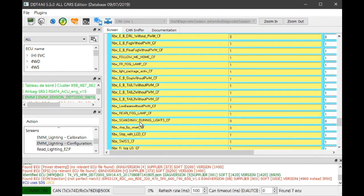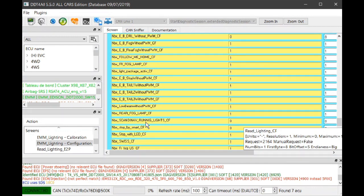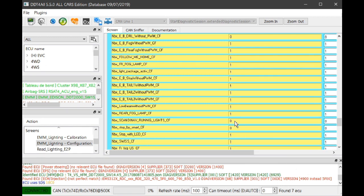'Scandinavian running lights' — in Scandinavian countries there's a law that dipped headlights must be on all the time when the engine is running. If that's set to 1, every time you start your Clio the dipped headlights will come on as long as the engine is running — regardless of what you've done with the light stalk. When you turn off the engine the headlights go off. 'Stop by smart' — not too sure, left that at 0.